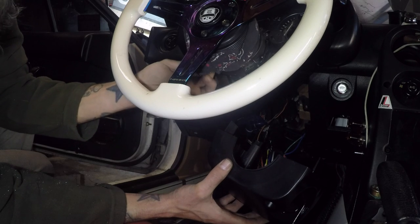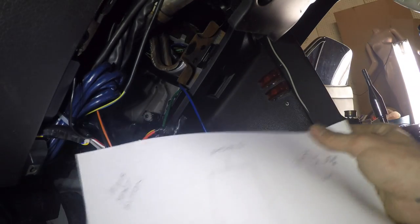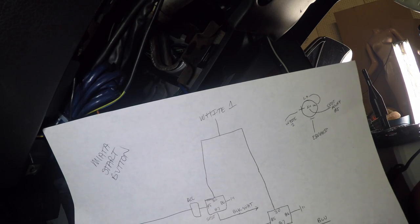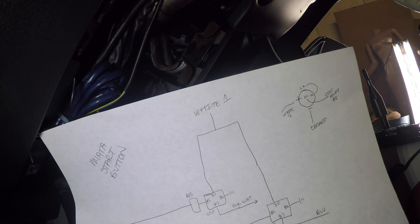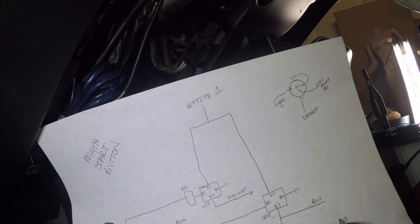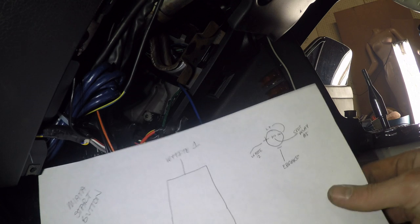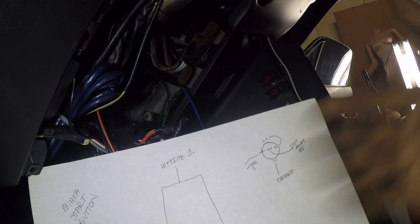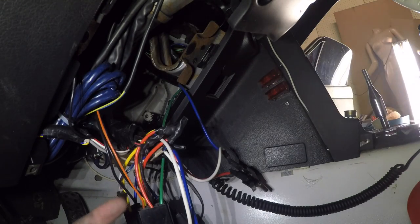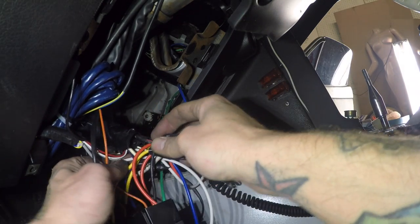Perfect example of why you want to test everything before you button it all together. Quick change from the wiring diagram — I had the start button being powered off of the constant white wire, and that does not need to be that way. The wire coming off the run switch needs to power the start switch, otherwise the light on the start button is lit all the time and that will kill your battery. This way the start button only becomes activated if the proper run switch is activated. So this line going to pin 85 on the relay can get split and go to the start button — everything else is exactly the same. If you have any questions, comment below.